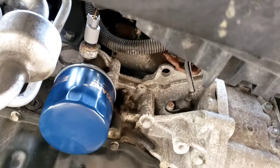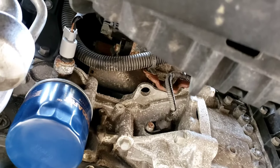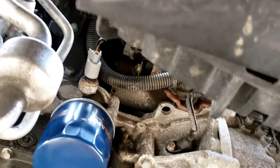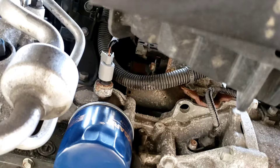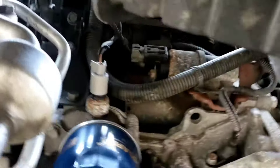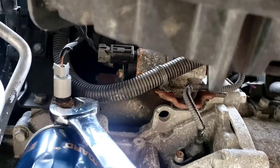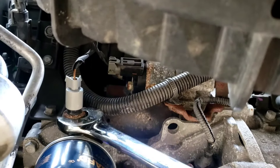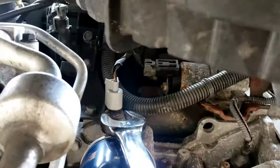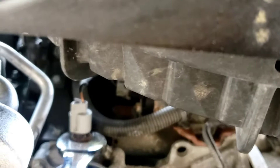From here you can really tell how that clip comes off. I tried to squeeze from the side — it looks like a little V — but you can't really get it. When you're unfamiliar with a clip, especially on a sensor, what you do is take your wrench — this one happens to be a 24-millimeter — and spin the whole connector and switch.